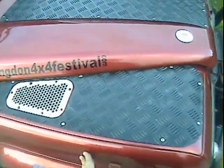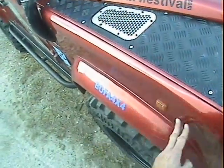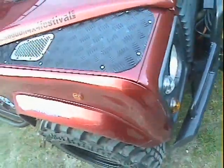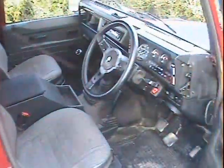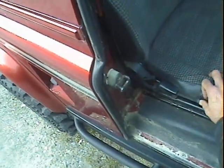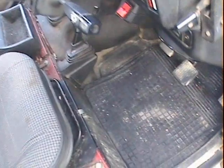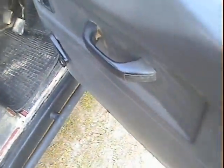The offside front wing has a very slight depression around the sidelight area — it hasn't really dented it too badly and hasn't broken the paint; it might be pushable out. The offside front eyebrow is quite badly scuffed along the edges with a couple of very deep scratches. Inside on the driver's side, the seat cushion has lost a bit of its shape and the vinyl has got a bit of a tear — a new cushion wouldn't go amiss. The footwell looks okay, a bit wet but it's just been jet washed. The driver's door all feels nice underneath.